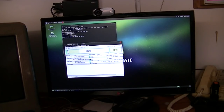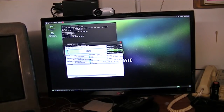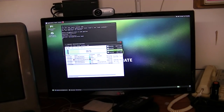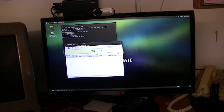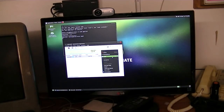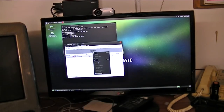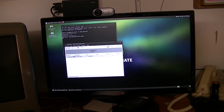Okay, it's set to the SSD. We do not care about that. Okay, there's our new drive, 3.64 terabytes. And here's our old 2-terabyte drive, and what I want to do is simply copy and paste it to the new drive. No partition table found. Okay, I guess we'll have to create a partition table.